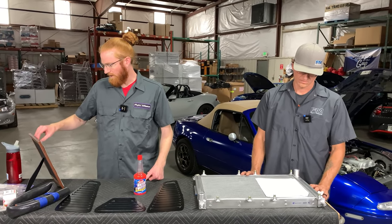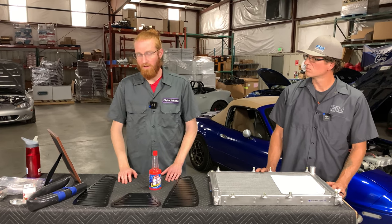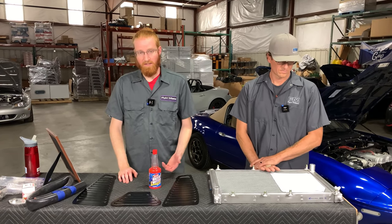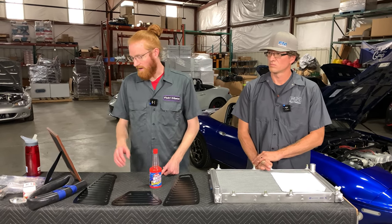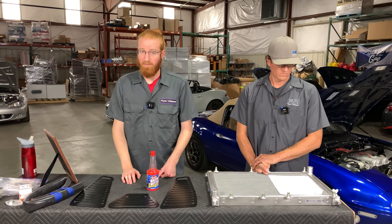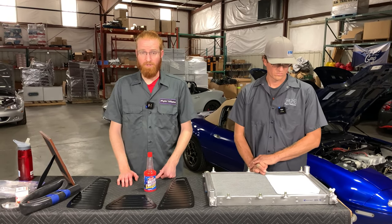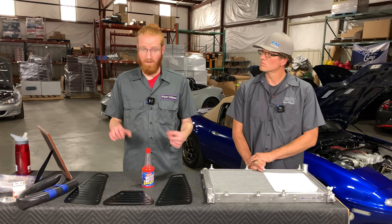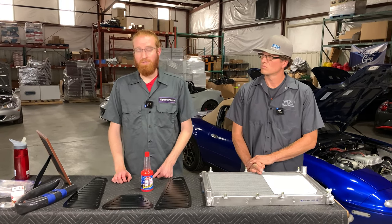Question: how do I know when I need to upgrade my cooling system components? Mostly for NAs and NBs: if you're seeing that temperature gauge move past the 12 o'clock mark, it's likely time to begin at least looking into the current state of your cooling system — checking the rubber hoses, checking coolant condition, and all the other things we discussed at the beginning. When you see the needle moving to the 1 or even 2 o'clock position, that's when it's time to consider pulling over and turning the car off. If your radiator tanks are starting to look worse for wear, it's a good time to replace the radiator, change all the coolant, and build from there if you're still seeing overheating issues.